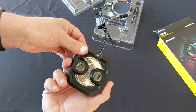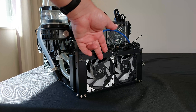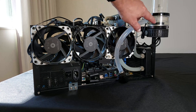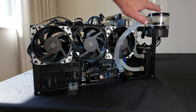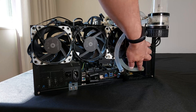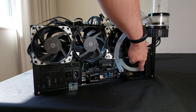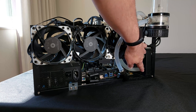Out of that box, that's the only piece we're going to keep and use. Now last time I changed the water cooling on this rig, I made a critical design error. I put the radiator and fans down here and that part's all good. But I left the drain valve connected to the reservoir, which used to be the lowest part of the system. The problem now is the lowest point is actually this radiator valve. I'm going to fix this by putting in a T-valve here and a new drain plug, which will be the new lowest point. But unfortunately I'm just going to have to go through the horrible process of draining it so I can fix it properly.